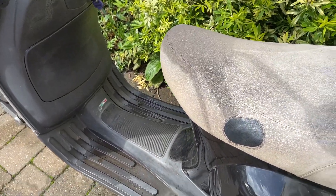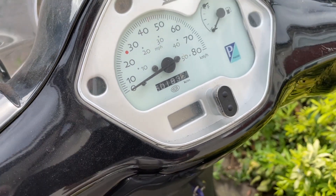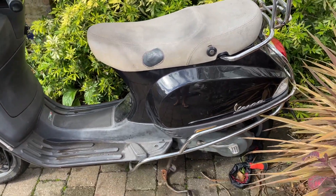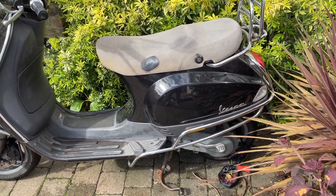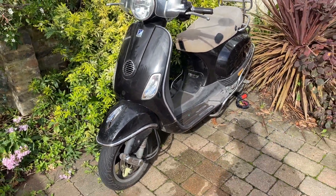It's actually in decent shape. It's got 50,183 kilometers so it's seen quite a lot of action. One of the reasons it was so cheap is that there's an issue where it cuts out at full throttle — not even full throttle, probably 70% throttle. It's probably an issue with the carb. Obviously if I convert this to electric then that's irrelevant.